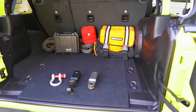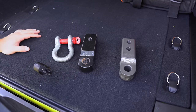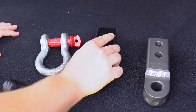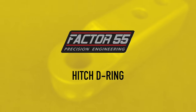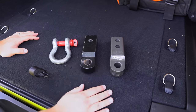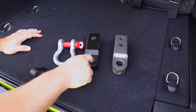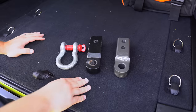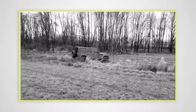If you're going to get anything specific out of number four, my must-have for the recovery kit would be hitch-mounted D-rings. I have two different styles. One is completely steel — it's a very heavy piece, it's nodular and starting to rust a little, but it does the job perfectly. Next to it I have a billet D-ring made by Factor 55 with a max load of 9,500 pounds, made in the US, with two tether mounts as well as the D-ring point. It's a lot lighter and looks better, but about four times the cost. A standard D-ring shackle coupled with a recovery rope can get you out of 95% of the situations you'll encounter day-to-day, in snow, mud, or on the beach.